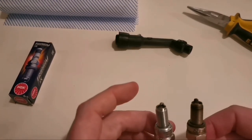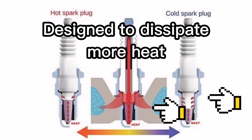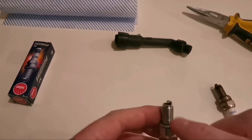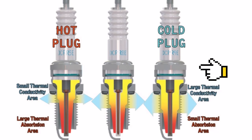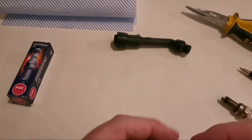That doesn't mean I'm going to run this for a hundred thousand miles - I'm still going to take it out and change it occasionally. As this gap increases over time the spark becomes less consistent, but there'll be almost negligible wear on the iridium tip, which means the spark remains consistent. Iridium is not as efficient when it comes to heat displacement - the way this is configured it's a colder plug, meaning it'll dissipate more heat. Just do a little bit of research to make sure you get the right plug.